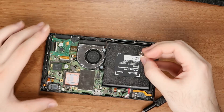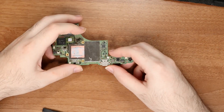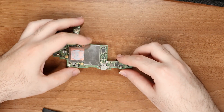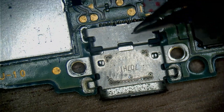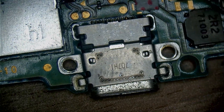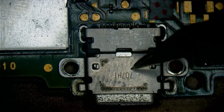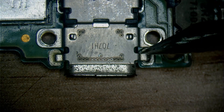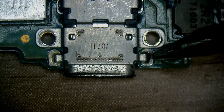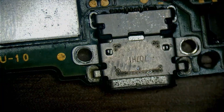Even if this gave us consistent charging already, I would probably change it anyway. Time to take the motherboard out. So apparently the heatsink was crushed — a little fin came off. The connector is absolutely... oh god. It's completely disordered; I don't think anything is holding it down at all, maybe a few pins. Here, the leg has completely snapped. Here, the leg is still here but the solder has completely been chewed up, so it's free moving. The legs are still here but the solder is not doing anything anymore.